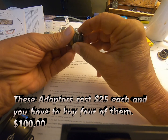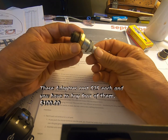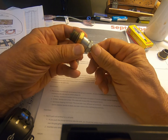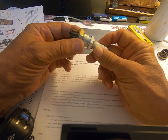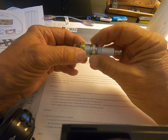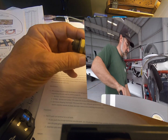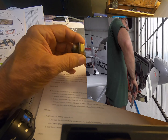Once you get the plug in, you screw it into the cylinder and tighten it down just finger tight — nothing more — just as tight as it'll go, making sure that the washer is snugged up against the cylinder. Then you put your torque wrench just over the plug and torque just the plug to 18 foot-pounds. As you torque the plug, the adapter is going to also tighten up some, and once you get to 18 foot-pounds you're done.